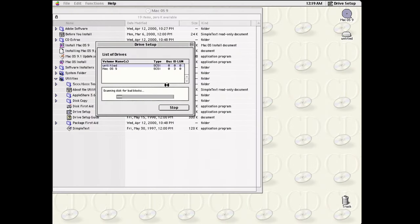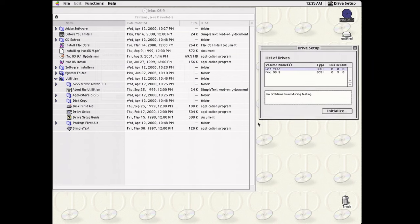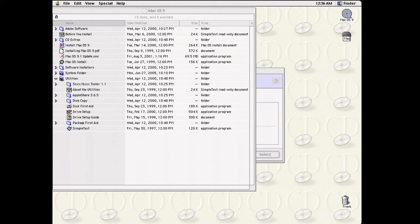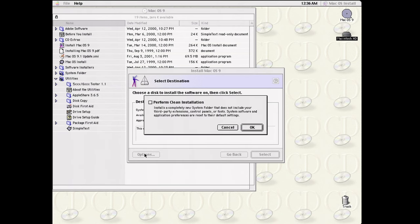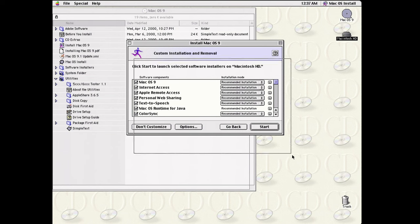But yeah, the replacement drive, believe it or not, even though it's, I think, older than the one I pulled out of the machine, it's about 1 gigabyte in size. After half an hour, it did test fine, and I got all the jumpers all sorted, so it all registered with the correct LUN ID or termination ID. Yeah, I've got to call it Macintosh HD. I mean, you know, this is a vintage or an older Mac, so yeah.